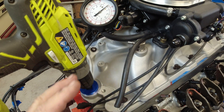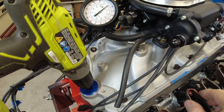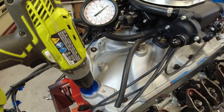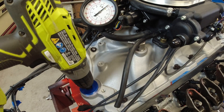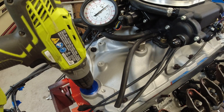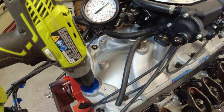So I'm going to go ahead and put the distributor back in. I'll get it lined up — I want to set it about 8 to 12 degrees before top dead center on a static timing. And then once I get the car fired up, I can do my advanced timing and get it set where it actually needs to be. You just drop it in so your rotor — you've got it on top dead center on your harmonic balancer. Let me show you over here.